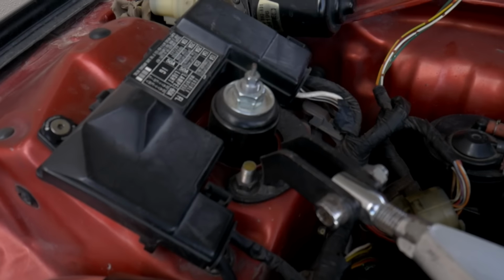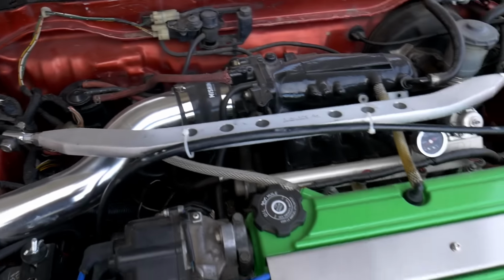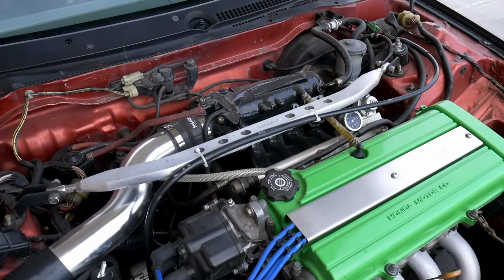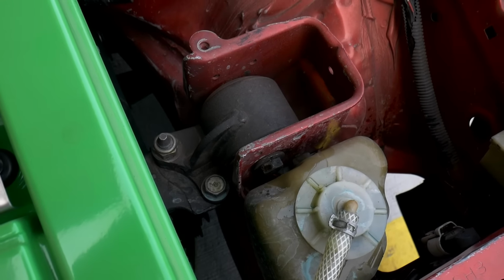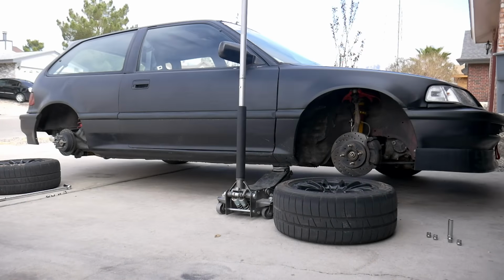We have extended top hats on top of the Koni shocks. Cheap OBX bar. I'm sure that it's probably not the best. I just left it on as soon as I had it. I wanted to get an upgrade, but haven't been able to yet. I have the innovative swap mounts. They're the steel mounts with the urethane inserts. Now I'm gonna share the suspension setup with you.